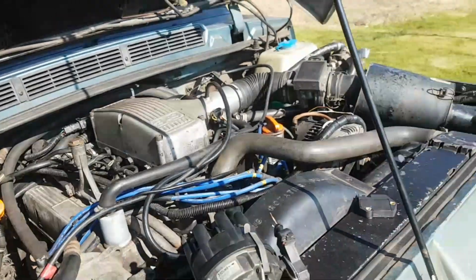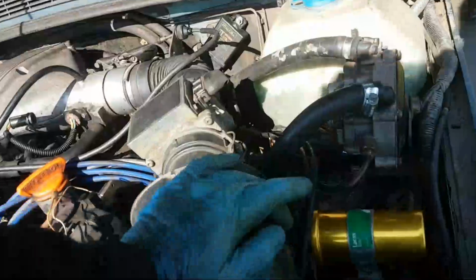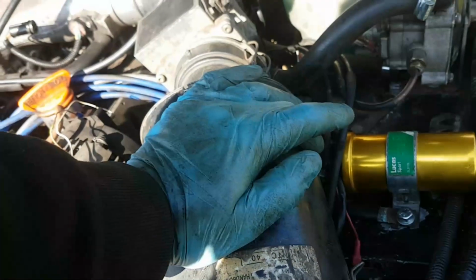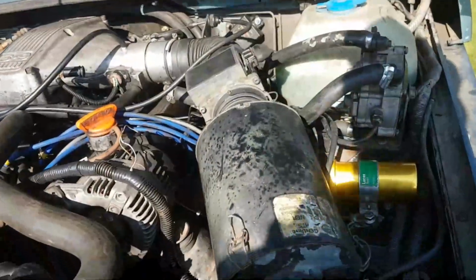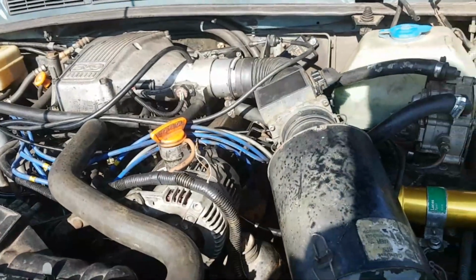I got all the way down to the one where I was checking that the ECU was receiving a trigger from here, from the coil on the black and white wire. And I couldn't really check it, because a multimeter is not going to be quick enough to pick up that signal. The engine's rotating at, I don't know, 150 RPM.